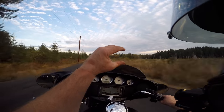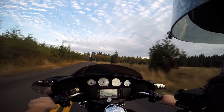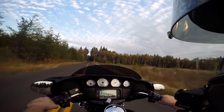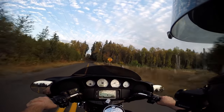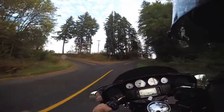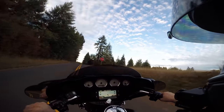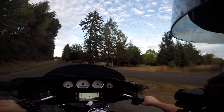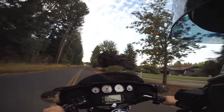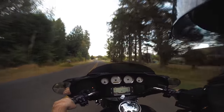But that compensator spring, the little small one that's up in the cup, what that does is it's a pre-built 1 inch of sag in it, which should be enough. But it looked like I was getting a little additional, and I couldn't tell. I was gonna end up dropping the bike before I got a good look at that tape measure. Have to rig me up something here to sort all that out. Rig up a laser on a tripod. Get a reference that way as well.